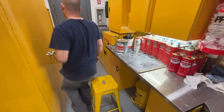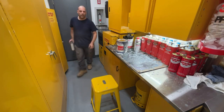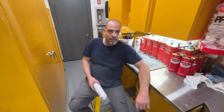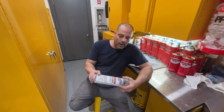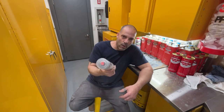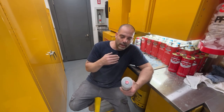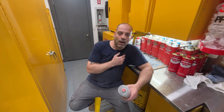Let me show it to you. What we'll do is a dealership parking lot repair on those inside couple little dings. We'll hit them with some body filler, and then we'll spray some of this Spray Max 1K primer over the body filler. This stuff takes about an hour to set up, and then you can lightly sand it down, and then we'll get it into epoxy primer, and we'll paint the inside of the door satin black on Saturday.